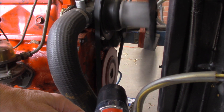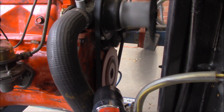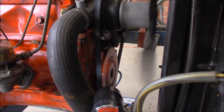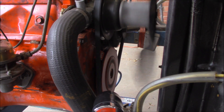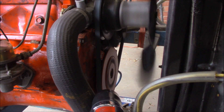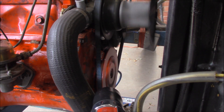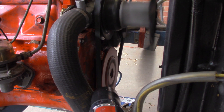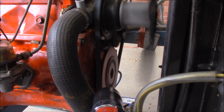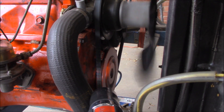Can you see where that mark is? It's miles out. I'm going to rotate the distributor now - see, wrong way. You can see how far out it went that way. Let's come back a bit. I've just pulled off my vacuum advance - did you see the amount of difference that made? Now we're after 8 degrees: two, four, six, eight - and that's actually spot on right there. I'll tighten up the bolt now.